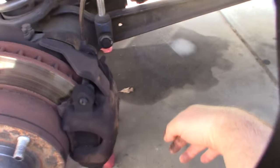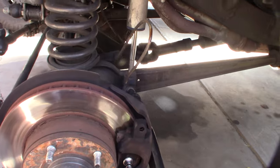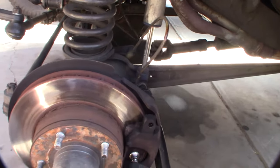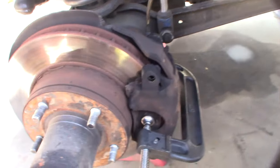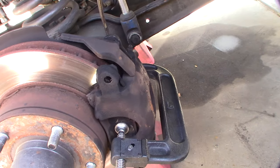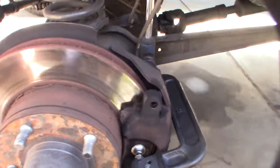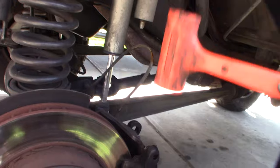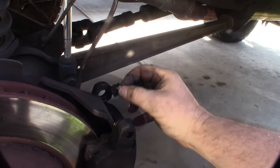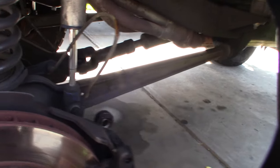Like I said, it's a Chevy conversion — the '76 Blazer. Let me try to push this piston back a little to make it easier to remove. It feels really stuck. It's either debris in there or it's bound up sideways. I can't push it back — it seems like one of the bushings came out. Those are getting worn out too — I'll need to replace those.